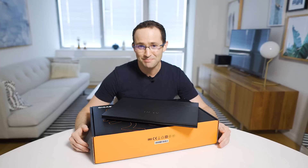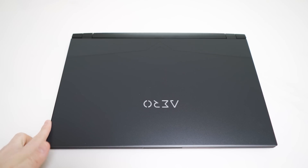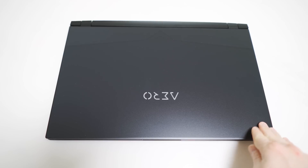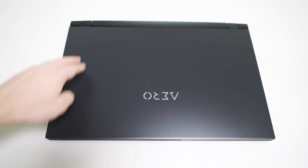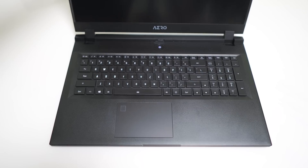To test the trackpad, you can try playing a mouse accuracy game like the one at mouseaccuracy.com — link in the description below. Look very carefully around the laptop in a bright room to make sure there are no dents or scuffs on it. Run your finger very gently along the corners and edges to ensure they aren't too sharp. Place the laptop on a flat surface and push down gently on each corner to check it doesn't wobble. Open and close the lid a couple of times to make sure it's sturdy.